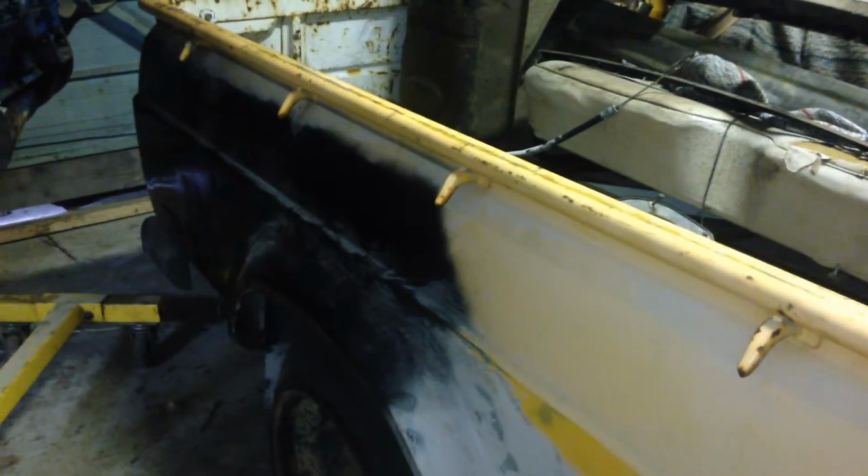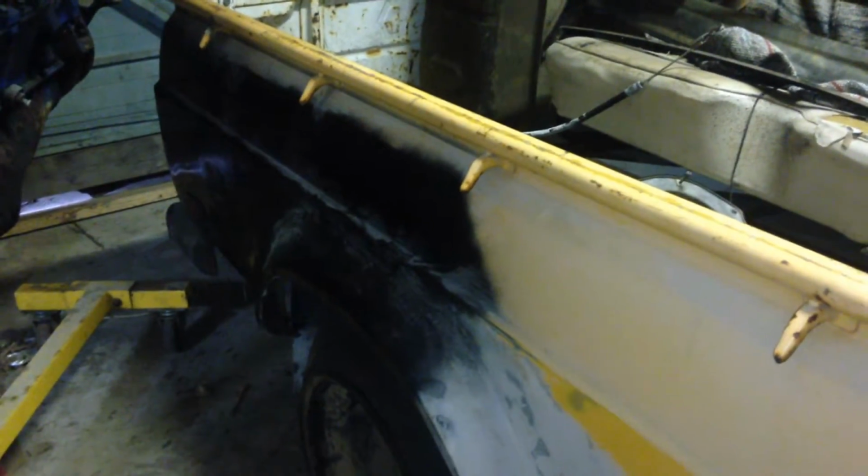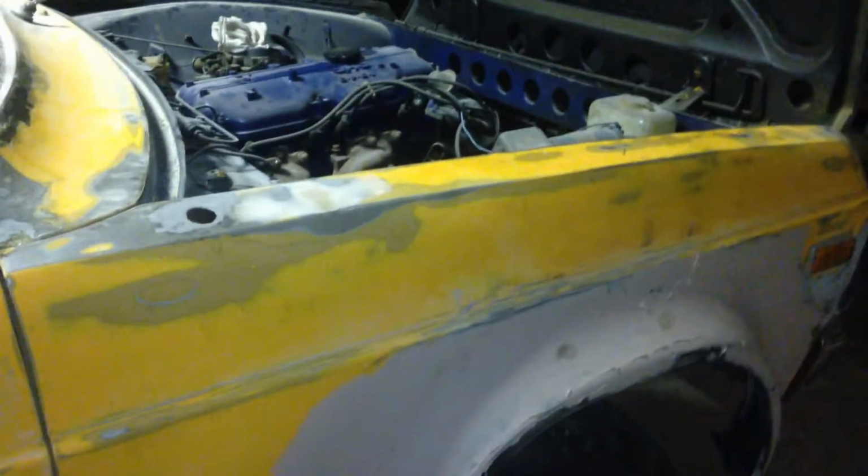The fender flares are off of like 79 to 83 Toyotas. All front fenders, because the rear fenders are just a plastic molded piece. So I cut apart 4 fenders and individually channeled them to work and fit. Each side, the fronts were the same per sides, but backwards. And then the back is different altogether.